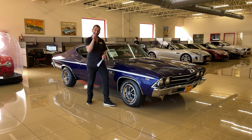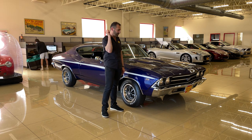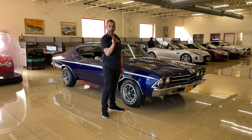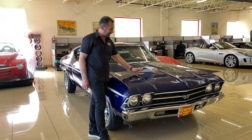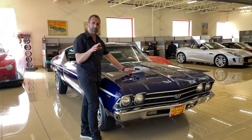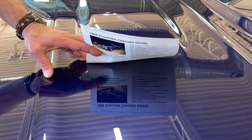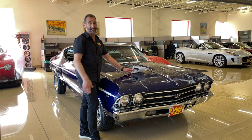We'll talk about quality of paint because paint matters. You say, well, why does paint matter? Because every car is shiny? No, every car is not shiny. They look great in pictures, but they don't look great in person. It's important for you to know how and what to see when you're looking at paint — because if you're going to go to a car show, which I think this car qualifies for, you'll want it to look good when you pull up. When you check paint, you want to see crisp letters where you can see every single letter, every detail, nice and fine. The better the paint, the better the quality the letters appear. When you see letters with cloudiness, that gives you an idea that the paint is not as nice in person as it is in pictures.